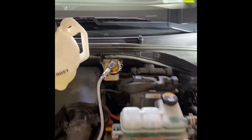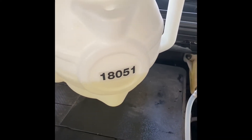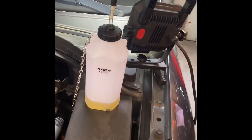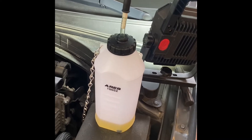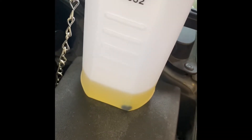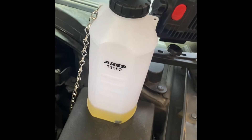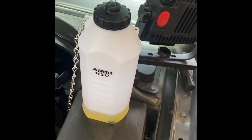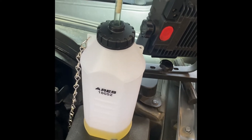I filled my reservoir with DOT4, hooked up, and pressurized the system. I'm going to install this catch can to each wheel cylinder and go around and flush out the old stuff. I added a little fluid because this hose reaches down in there. In the event you're doing the old school pump and bleed, if you close it too late, this will keep air from entering the system.